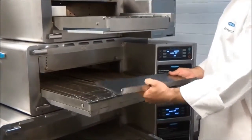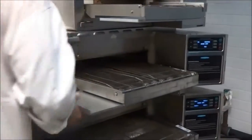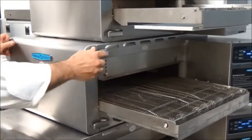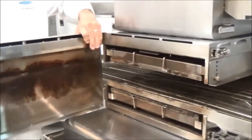What we're going to do is pull the extenders off, the chain guard, and then the crumb tray underneath. I'm going to place that on the cart so I can transport it a little bit easier. I'm going to open the door by just removing these latches — it's going to come out and lift straight off.